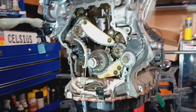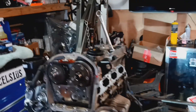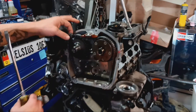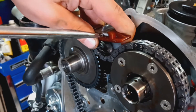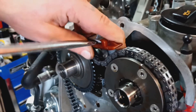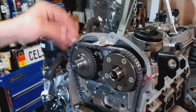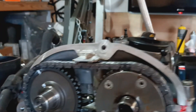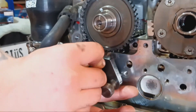After that we're on to the main chain. To get the upper guide off, first flip that up, put a flat head right there with that little lip, pull down a little bit, crack this hole, and it pulls off the lip — flies right out. That will be the last guide we put in. Then we want to line everything up. The black link is matching that tooth, so we'll go ahead and put the tool in for that one, which lines up in the cam bridge spot.